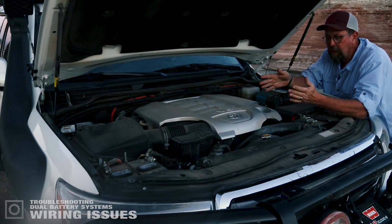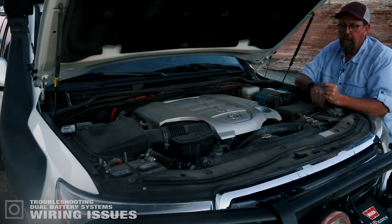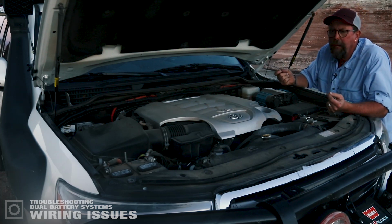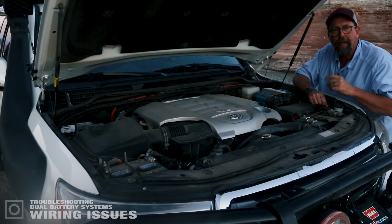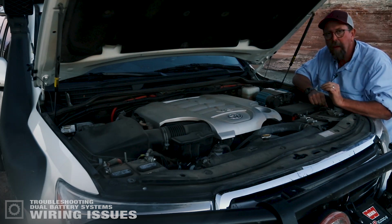The easiest thing you can do is to go to the negative battery and take that little black wire off of the circuit board there. That is in essence like booting up your desktop computer again. By disconnecting it, it powers it down. By reconnecting it, it restarts that firmware on that circuit board and clears a lot of the problems out.